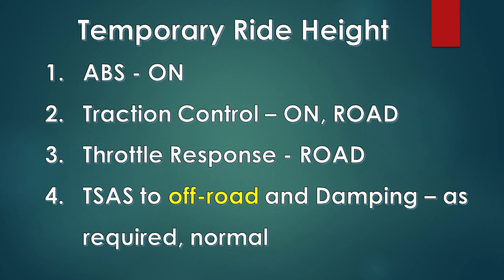The first custom mode — one I use all the time and made a longer video about — is an off-road mode. You can set the T-SAS to a much lower preload in that off-road mode but leave ABS and traction control on. So if you're going down a busy high street or crossing a campground, you can lower the rear preload, lowering the back end of the bike on the fly. When you leave, without stopping, you set your rider mode back to road and the rear end lifts again, putting preload back to its normal place.